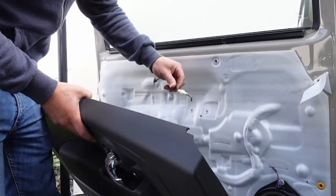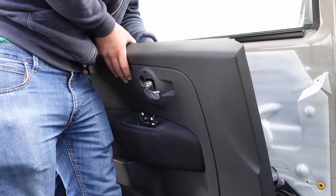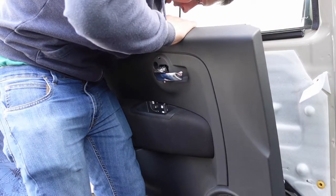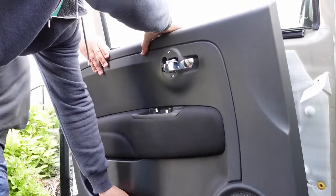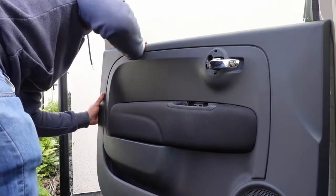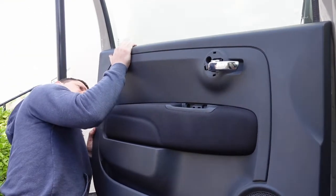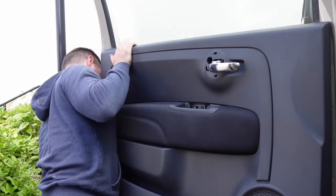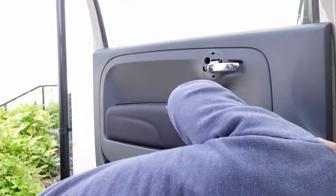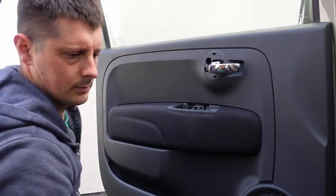You want to reinstall the 10mm bolt, and then this rod back on. Is it working? Right, door card's ready to go back on, but first we need to reattach the opener. It's exactly the same process in reverse - hook the door card back on the top, and then just push these clips back in. And that's that.